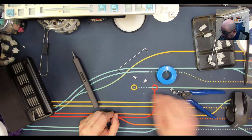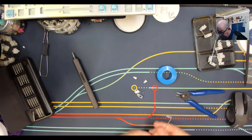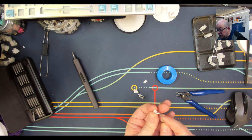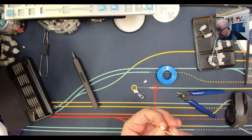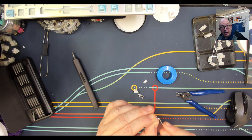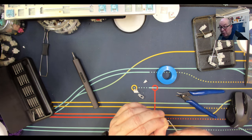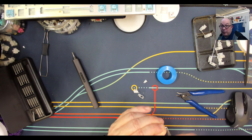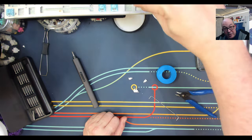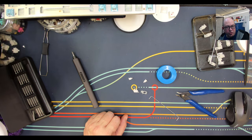So you're left with a little Z of the legs. Now, the housings should be fine. But what happens is that while these are inside of the stem, going like this, if you notice, there's a little bit of play. Now that play is intentional, but sometimes that play is a little too much, and that's what causes rattling. Many times it's also a combination between the housing not being stable on the plate, and the looseness and the tolerance being there.